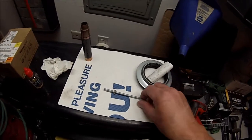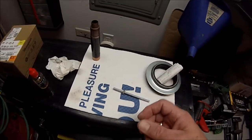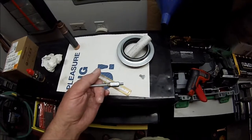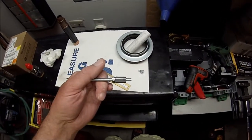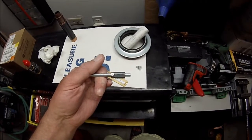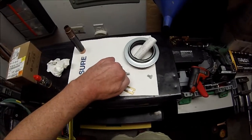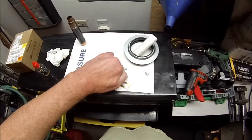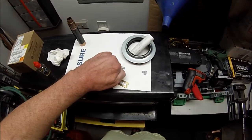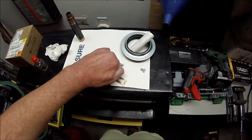But right now we're going to shorten this by about 8 millimeters. Now there's ways to mark the 8 millimeters. I'm just going to use two nuts sort of snugged up against each other. I'll cut right up against this coupling nut later, here in a second, with the disc, and then we'll chamfer the edges of the new cut so that the nuts go on and off easier.